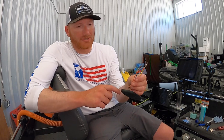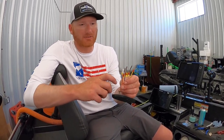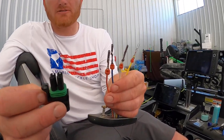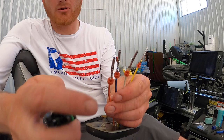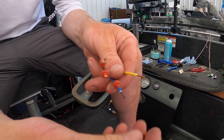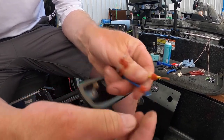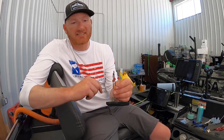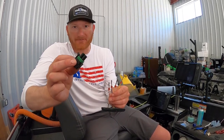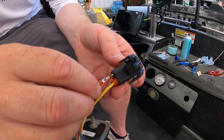Here's the fitting for my little Ranger pad — I've got the little ends crimped on there, basically a male and a female. You have to put the right one to the right side. All four of these go in, and then there's a little boot that butts up against there to help keep the water out. Before we put this together we're going to put a little dielectric grease in each one to keep it from corroding like the old one was. We'll have a nice watertight fit on this connecting harness, yet we can disconnect it if we need to do some service.